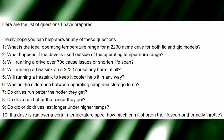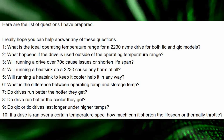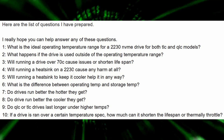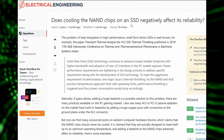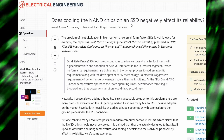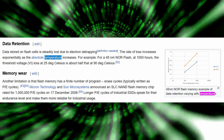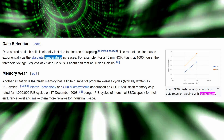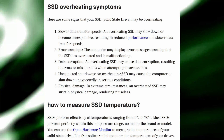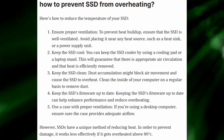I asked every one of them 10 questions you're going to see next, including questions that may seem a bit silly, but they represent some of the myths and rumors that have been spread far and wide on Reddit and Discord. You're going to learn how important keeping NAND flash cooler is rather than hotter — it's imperative for data retention and lifespan. I think it's an important topic because there are a lot of misconceptions, and people don't quite know if they have a temp issue until it's too late. My goal is to help you get the most life out of your drive.